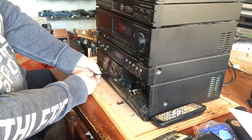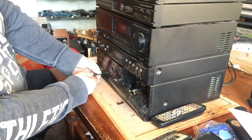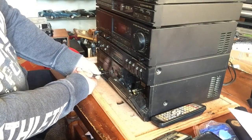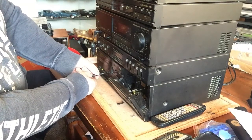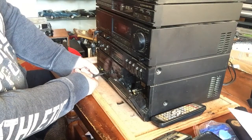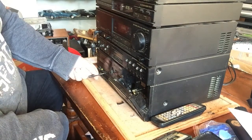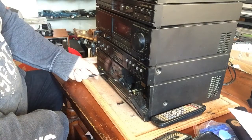What I'm also doing is looking at the outputs on the graphic — 12,000 Hz. What I'm aiming for — you can hear the difference in the tone. Also, where I can see from looking at the level meters on my 8-track player, because they're nice easy-to-read meters — I'm looking for maximum recovered audio, but also the balance to be right between left and right-hand channels. And that is about spot on.